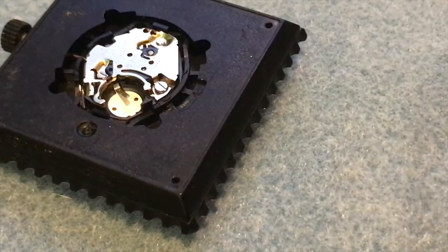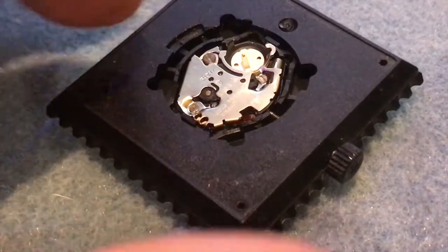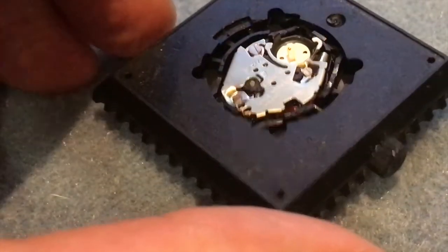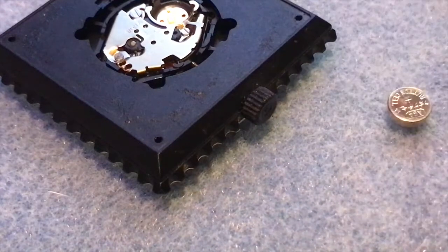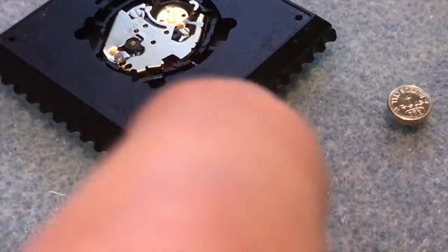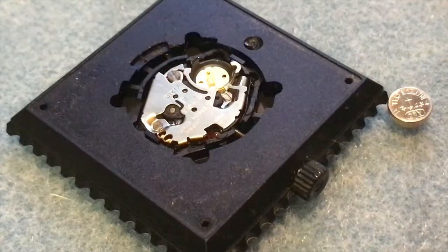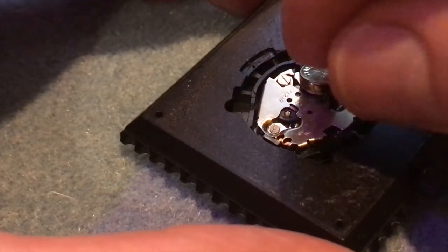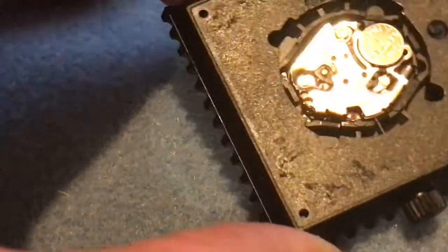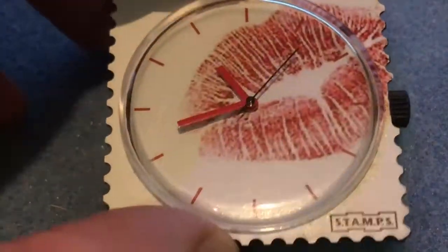Now get the battery that was cleaned. Turn the watch so that the lever is facing away from you, take the battery with the circle on the top facing down so you can see the back, and move it in by pushing it underneath those two spikes. Coming from behind — there's the battery — push it down and forward, and that's it, the battery's in. Spin the watch over and we have a ticking second hand. I always love it when it works.